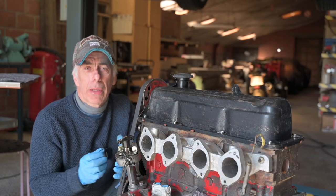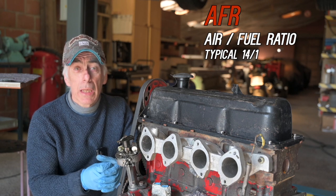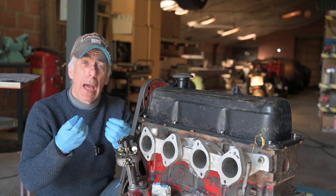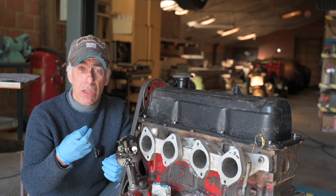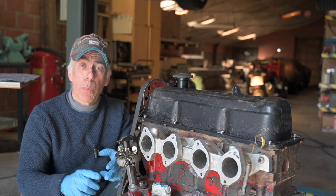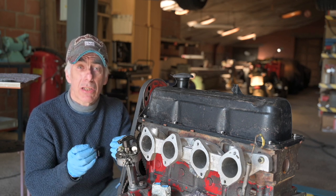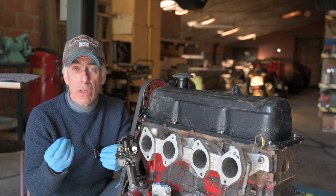What's the purpose of a carburettor? The carburettor has to supply the proper air-fuel mixture — a 14-to-1 ratio typically — into the intake manifold of the engine, and it has to do that under all circumstances: idle, acceleration, cruising, full open throttle, or very extreme cold situations where you need a cold start. It has to deliver the right amount of fuel — not too rich, not too lean.